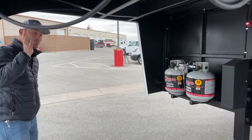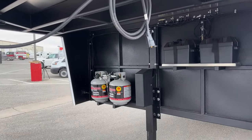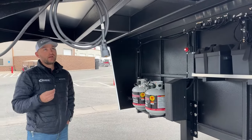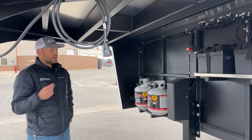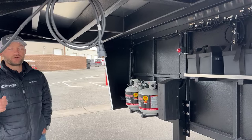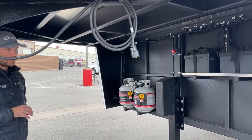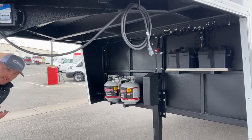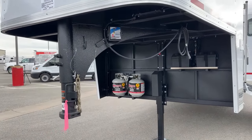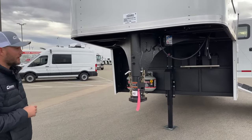The same rhino lining that's on the floor in your hauler area is going to coat pretty much any exposed steel on this trailer as well. It's basically a rhino lining product — super hard, like a super hard rubber. Anything that hits it, rock chips, whatever, is just going to kind of flake at that rubber. It's not going to ding up your steel or aluminum, and it'll really help keep this trailer looking good for a long time. If you do get a rock chip that chips away at this, it's easy to grab a rattle can of rhino lining from Home Depot and touch it up. We've had to do it here — it's really easy to maintain.